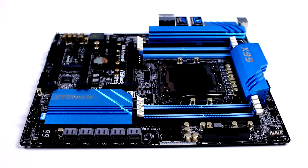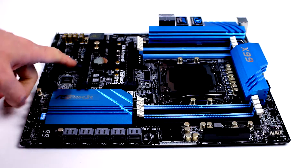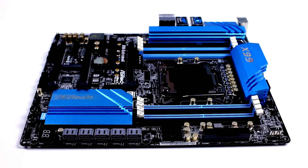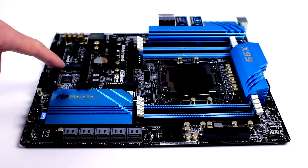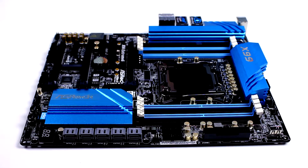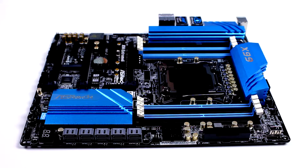Overall it just seems to be a really nice board. I'll build with it and if I have any weirdness I will let you guys know. One more thing I should mention that I missed with slots — there's a mini PCIe x1 right here. I don't know how many of you are going to end up using that, but it can be useful for things like adding in Wi-Fi and some other small things. I think that probably led to there being a little less PCIe slots on this — I kind of wish there was one more full-size PCIe, maybe just operating at x8 or x4 or something along those lines.